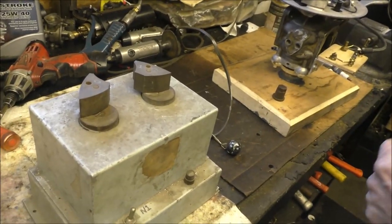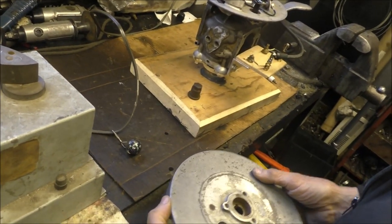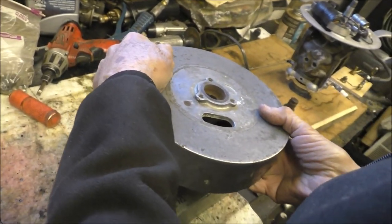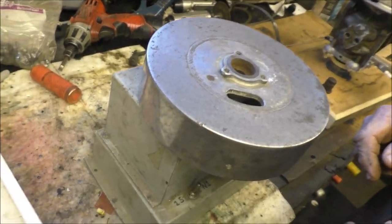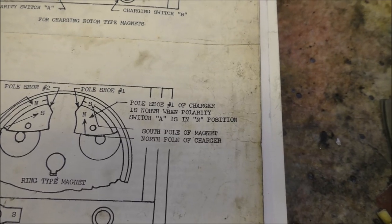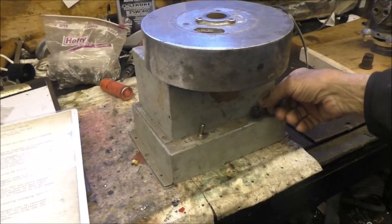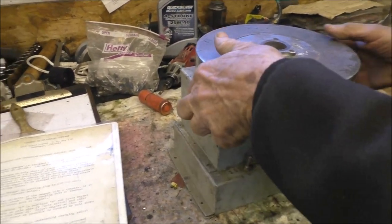According to the compass, which one did we say was north? That one right there — so you put it on this one right here and you should be good. This Stevens magnetizer has had all the rectifiers replaced with solid-state rectifiers, so it actually puts more juice into them. We've got pole shoe number two, we've got the north pole, the right pole, and the switch on north. Now we're ready to depress the switch. Pull up on it when you're done. Now we're charged, according to Stevens.